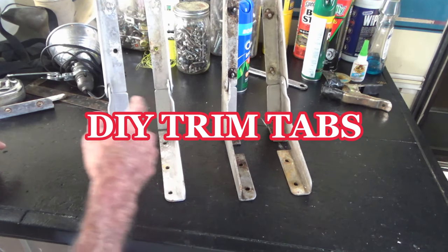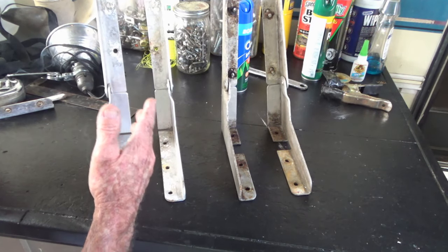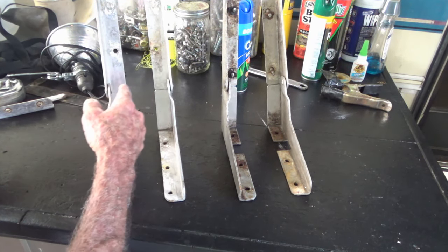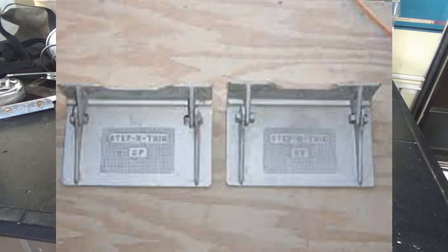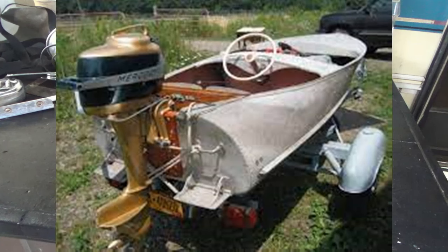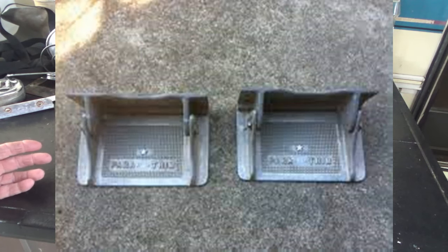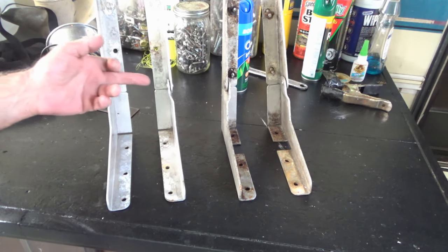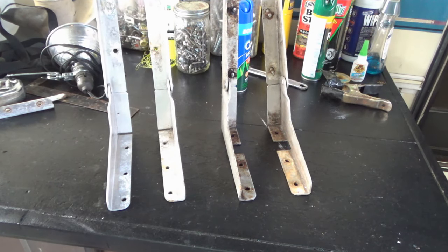Old school style. In the old days they didn't use little actuators — no electricity, no springs. They just used nuts and bolts and set it where it was best, then tighten that baby down. They were called stepping trims, and you could also use them as a step to get into the boat. Pretty heavy duty aluminum — thick, 1950s stuff. These won't be used as a step, but that's the old days way. Just bolts to hold them together. So I'll drill these out, put nuts and bolts in, maybe go a little bigger than what that hole will be — a little heavier duty.